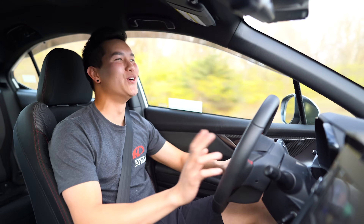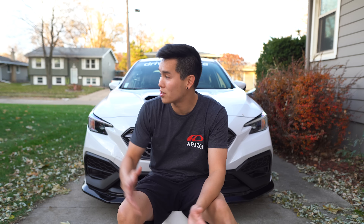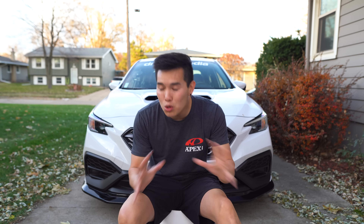This is why I love modifying cars — being able to go through that process gradually, installing different parts and feeling the difference. There's just such a satisfying feeling that goes with that, and we really didn't even do all that much. We installed a Cobb access port and flashed a new map, and now we see an increase of 35 wheel horsepower and 109 foot-pounds of torque, with the rest of the engine and exhaust completely stock.